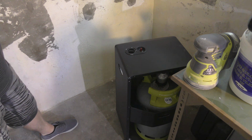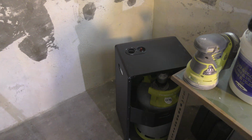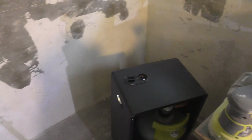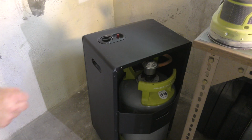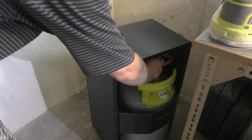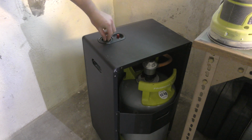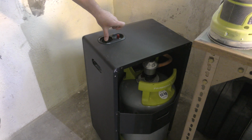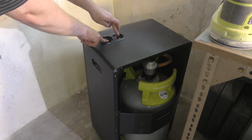It's not gonna burn, I just want to heat it up. So, not sure we have ever tried this, so let's just do this together. It's pretty much like any other gas heater. You buy these canisters, they're bloody expensive here, but there's a regulator that you open, and then there's a button here, and you put that to start, hold it down for a couple of seconds, and there is a spark thing here that you press.